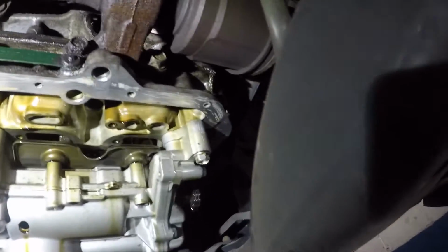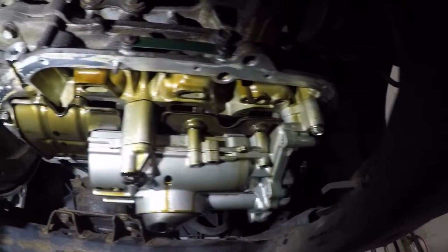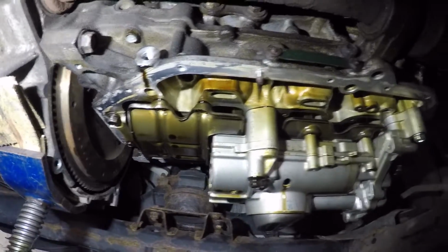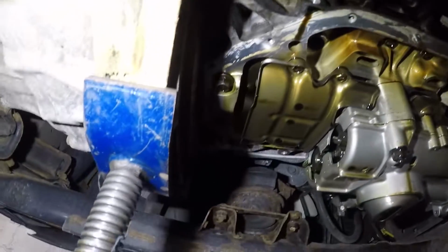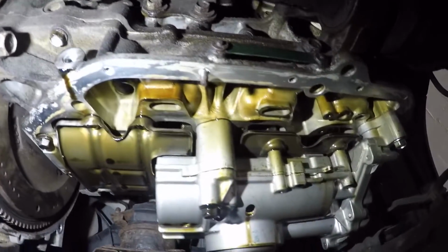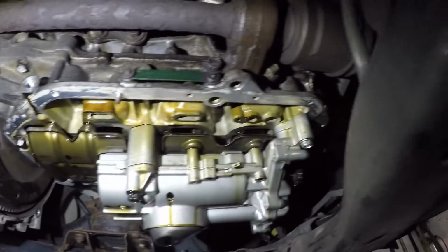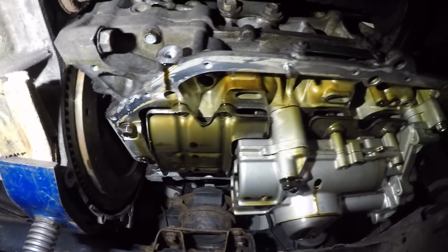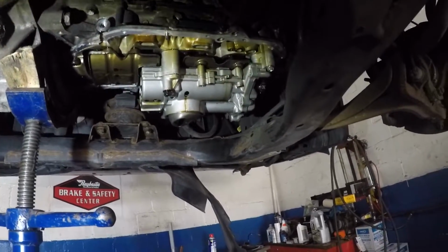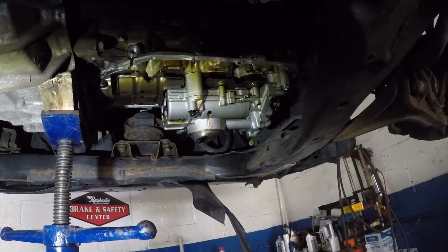All right guys, so I did a pretty good cleaning job here, and you see there's oil there. I'm gonna wipe that off before we put the oil pan in, because the Honda Bond we use cannot have any oil on it. So I cleaned all around, and I used the brake cleaner, sprayed it on a rag, and I wiped it down, because even though there's small little particles left behind, they're not gonna come off, right? And don't spray any chemicals on this, just try to wipe it down with something, and I'll do a little bit more job over here, and then I'll put my camera right here, and I'll try to put a light over here so you guys can see exactly how the pan is gonna go in. All right, so let me put the Honda Bond on the pan, and then we're gonna bring that over.